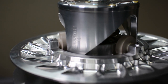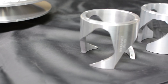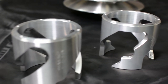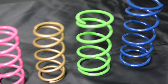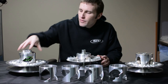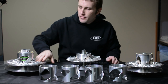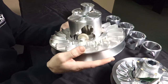Hey guys, I'm Dustin and today we're going to be talking all about tuners. We've got our STM tuner secondaries here and we're going to be talking about helix angles, spring rates, the difference between engine braking and encapsulated, and also a little bit of how our systems work. These are our secondary clutches for an XP Turbo — this is going to be a non-fin style and this is going to be a fin style, so you can see the difference with the raised fins.